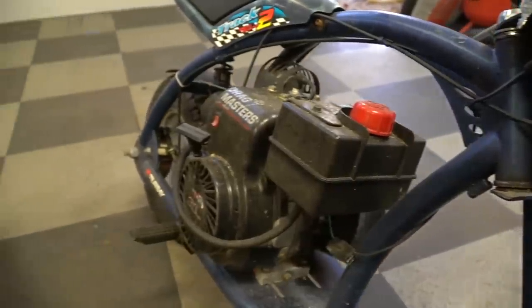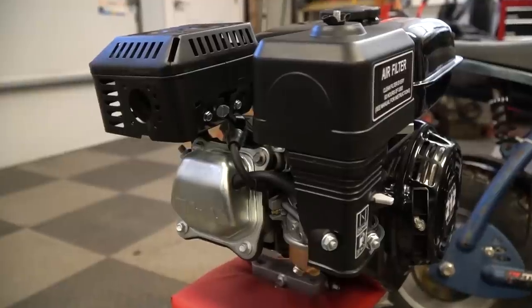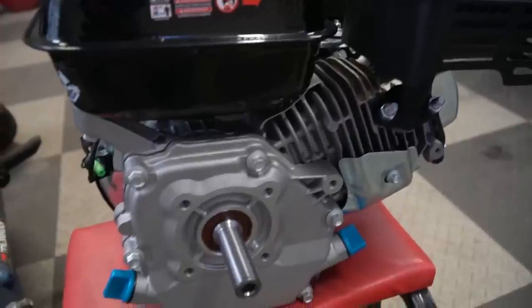Something perfect for a pretty beefy small block 212 on it. The Tillotson 212R is available at gopowersports.com — you can find links in the description of this video. Basically it makes around 12 horsepower right out of the box. It has a non-hemi 196 Tillotson head, the 196 Tillotson cam, and a flat-top piston, meaning there's a 13 to 1 compression ratio — something like that. Very hot engine right out of the box.